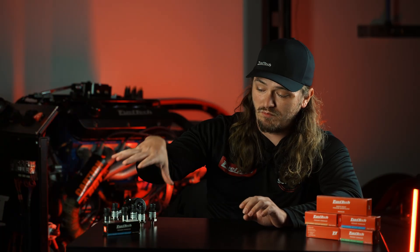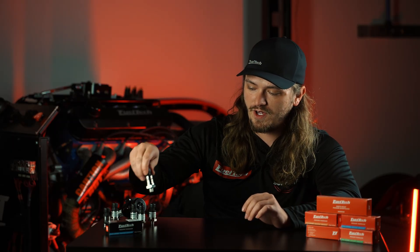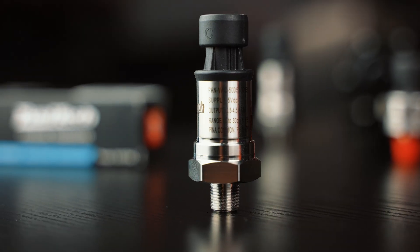For any of our absolute pressure sensors — anything that can read vacuum — we put them in a black box to make things easier. The first is the PanVac sensor: it can read about 15 PSI of vacuum and about 15 PSI of pressure. I most commonly see it on nitrous applications where it's critical for tuning, but it can be useful on any application — turbo, blower, whatever. It measures pressure in the crankcase and blow-by, so you can log it over time and catch something going wrong before something bad happens.